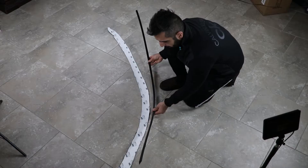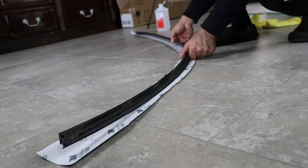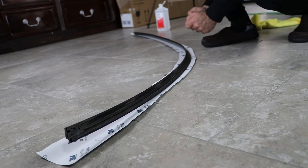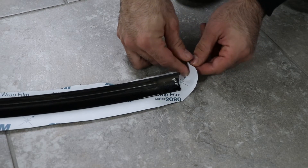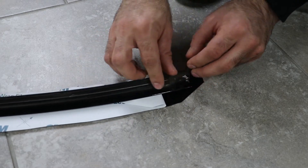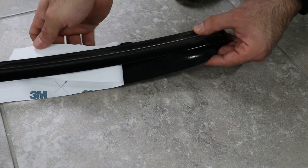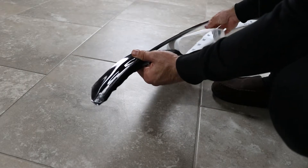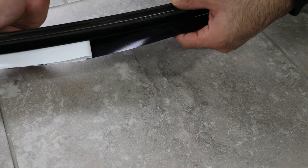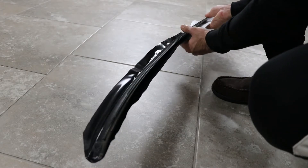While the rest of the vinyl is still connected to its release liner, reverse the wrap so that the release liner — or backing paper, or sticky end, whatever you call it — is facing up. Place the trim on the vinyl, then peel a tiny corner of the wrap and stick it on the trim. From there, slowly grab the backing paper and slide it off while the trim is attaching itself to the vinyl. This process helps prevent any unwanted dust particles or small fragments from attaching to the vinyl. Make sure your surroundings are clean as well, and again, don't do this outside — you will regret it.